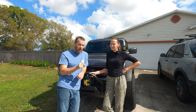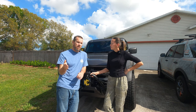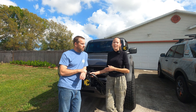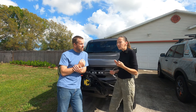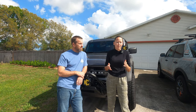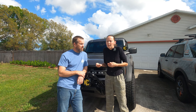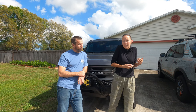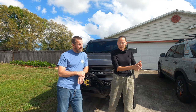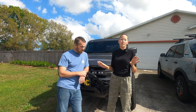As a critical point comes up where you really need to pay attention — especially when you save data — I will put in there 'do not screw this one up,' because this right here is your safe point. If you do screw up, you can revert back to that one. You have to treat what we're doing just like you would your home computer, because this is technically a computer on wheels. You do want to have multiple restore points so that if you happen to screw up, you can recover. Just make sure restore points are set and saved before you move forward, then save another restore point.